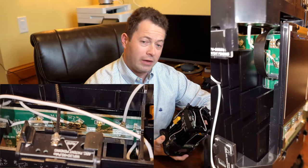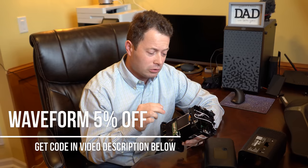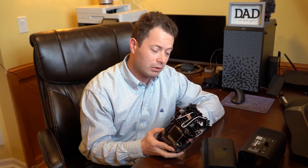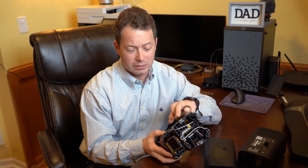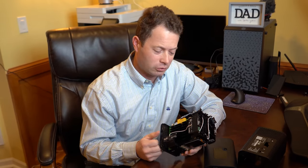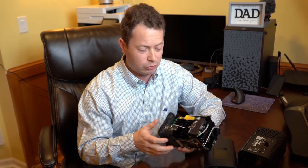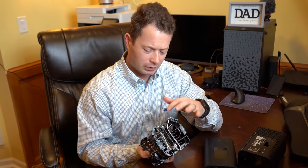I'm working with Waveform on this — I talked to them about their antenna options, and we think the same antenna that works on the Nokia T-Mobile gateway should work on this one. Our theory is to start with the D and M as the main ports, and then M1 and M2 would be secondary. I'll confirm that. It also has the same GPS, Bluetooth, and three or four small Wi-Fi antennas secured around inside.